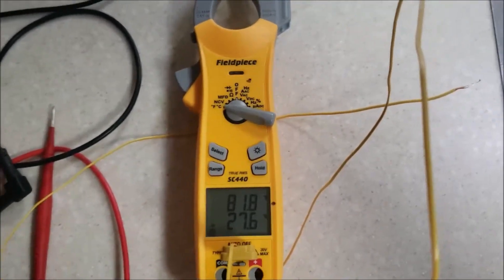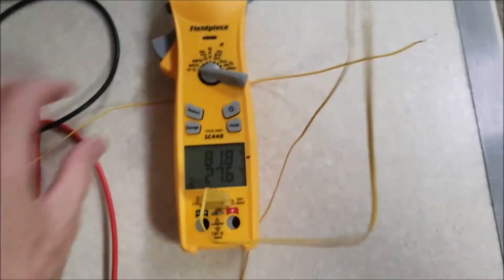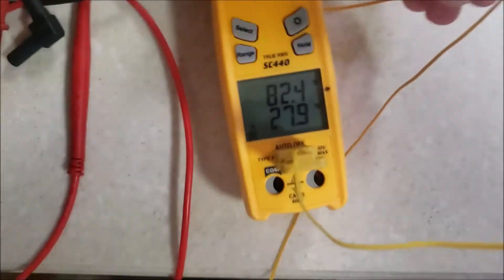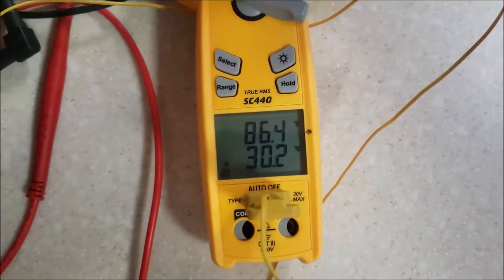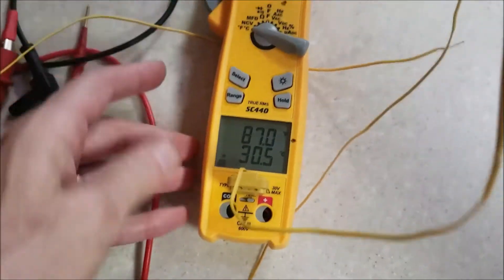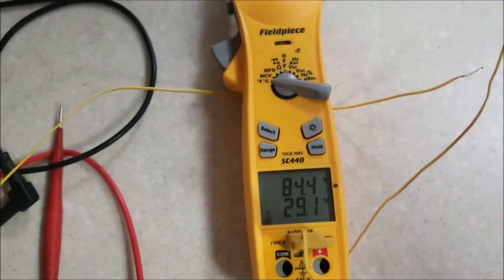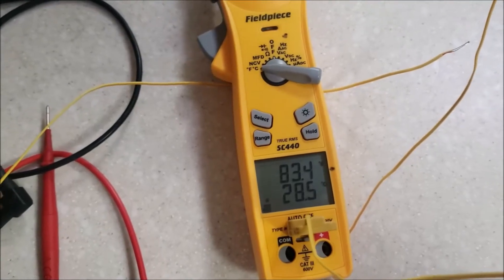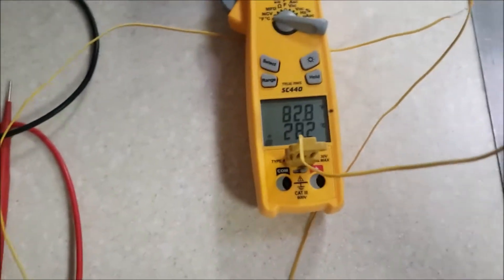This model is about $175, but it does so much. If you're on the road and have air conditioning trouble, with this meter you can measure everything you need. It's got a temperature adapter, and you can see how sensitive it is — we've got 83 degrees inside the RV. I pinch it in my fingers and you can see how quickly it starts climbing. I'm going to measure the inlet temperature and then the outlet temperature. According to Coleman's specs, I should see between 16 and 22 degrees of split.